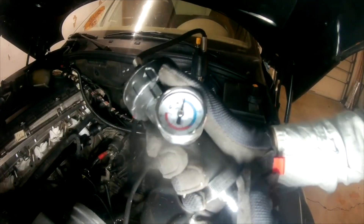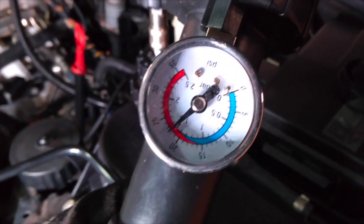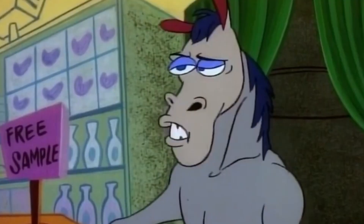After I did that whole coolant system refresh and upgrade I did a coolant system pressure test which came back great — it looked like a sealed system. But ever since then something has been just a little bit off. Whenever I check the coolant levels every two to three months, the bobber on the reservoir is always just a little bit low, and I don't like it. The coolant system is supposed to be a closed system. The only intended opening on the M52TU and M54 coolant system is the coolant cap.